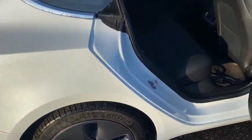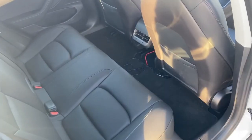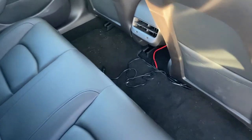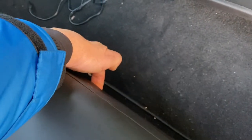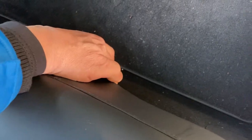Once you've powered the car down you need to wait about three minutes. While you're waiting you can go into the rear of the car and lift the base of the seat. Run your finger along the base where it joins the floor and part way along you'll find a little catch — push sideways and the seat base will lift. There is another catch further along which you also need to lift to raise the base of the seat.